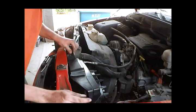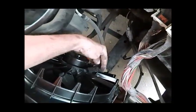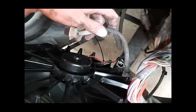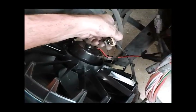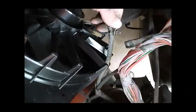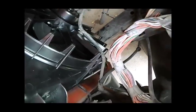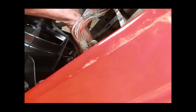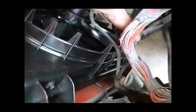The fan is in, all nice. It comes with a different style connector with a pigtail — go ahead and plug into that where the other fan plugged in. Actually, this pigtail is wrong, so we need to remove the pigtail and directly plug this into the fan. Got it plugged in. Go ahead and plug the old connector back in to whichever spot is most comfortable to hold the harness in place. It looks like there's a spot here and another one here. We'll plug that in after we move everything back, and re-secure this harness as well. Then I'm going to put the battery box back in.